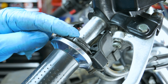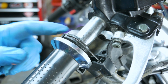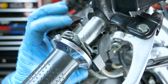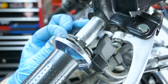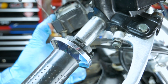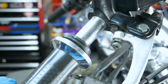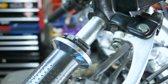Right, now you've freed up the throttle cable on the bottom, so you should be able to pull this down like that, and then you can unhook it like this, and then you can unhook the other one, which is right there, because you can turn this more. Right, and this whole lot, it's out of focus, but this whole lot is just going to sit there. Okay, so you get nothing connected. And then after you've done this, you can remove the other throttle cable from the carburetor.